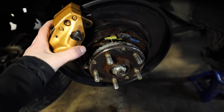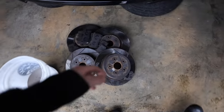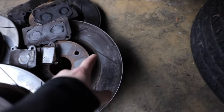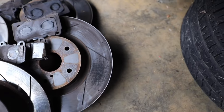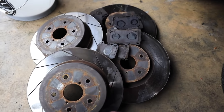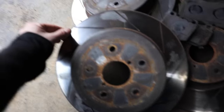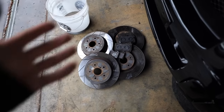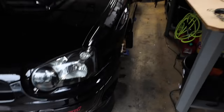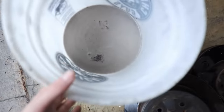These are the rotors we pulled off the car — it's a mismatched set. The fronts look like StopTech; the rears look like DBAs just because of that extra little breather port for gas to escape, but they're not DBAs so I have no idea what those are. There's still a decent amount of life left on the pads. The rotors have a pretty decent lip on them — I probably could have gotten away with resurfacing — but we've got brand new Centric ones coming that'll work perfectly for daily driving with some spirited driving.